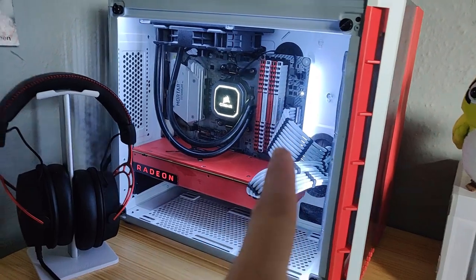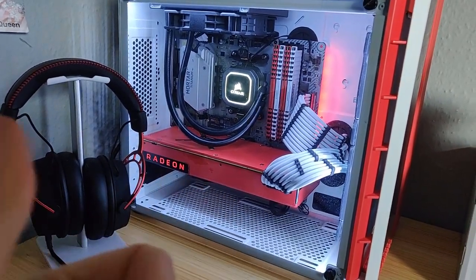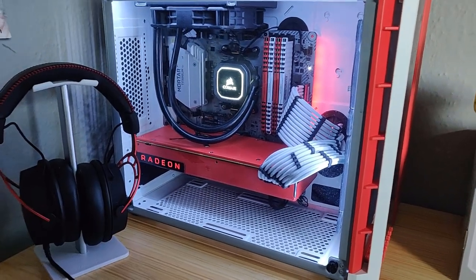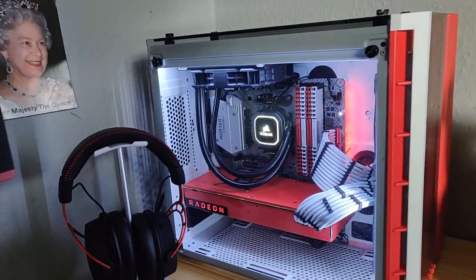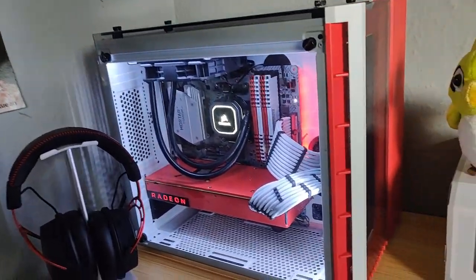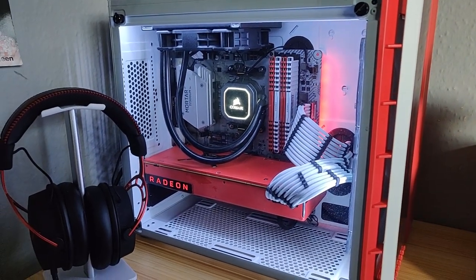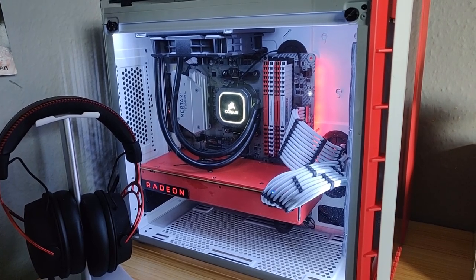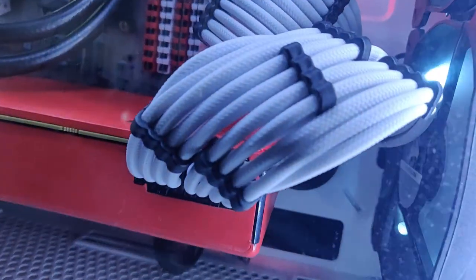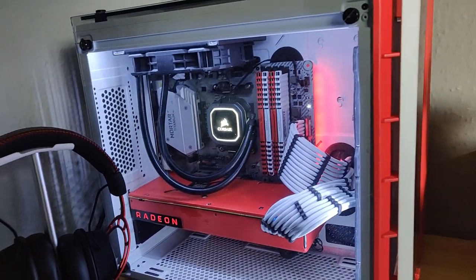Hopefully we'll get display. So it might have a bit of an issue because when I took it apart it only had 24 gigs of RAM — it's got 32 now, so it might not like that. It says not booting yet, so that could be an issue. Come on, boot — you know you want to. What does that say? VGA. What's wrong with the VGA? That means it's a graphics card issue, by the way.